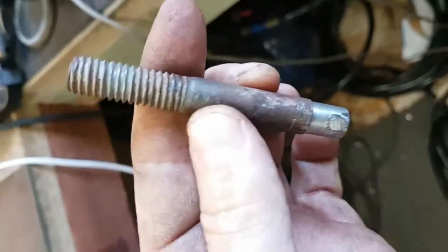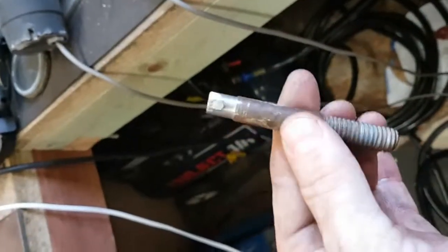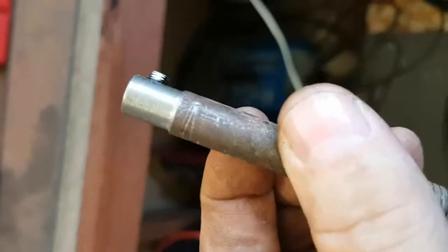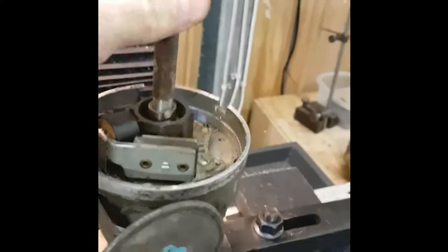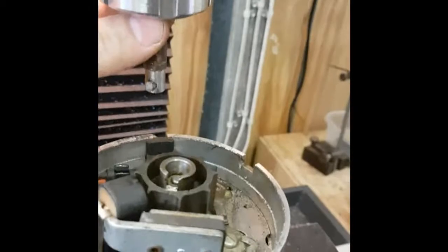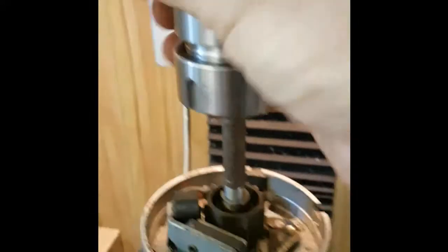I've made up this little piece — I'll just drill the hole into the end of it, then turn this bit down in the lathe to get it the right size, and I've got an Allen screw drilled and tapped into it to make a key. So now this will sit in like that and drive the distributor shaft. I'll put this up into the spindle, get it up high enough, then drop it down when it's in the right place. We now have it all hooked up and that all seems alright.